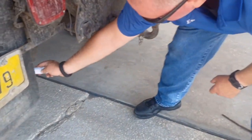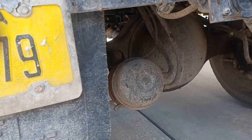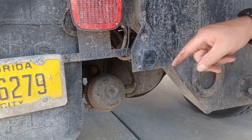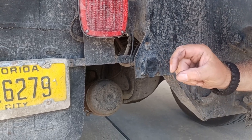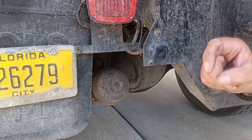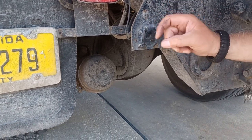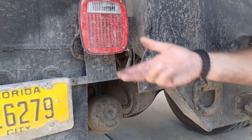Moving our way in from the slack adjuster, we'll see the brake drum and the brake liner back there. It has a dust cover, so we really can't see in there. What I would do is get a little inspection mirror, shine a flashlight in there, and look into that mirror to see whether or not you have more than enough brake pad. It should be more than a quarter of an inch — free of oil, grease, and debris, with no cracks. And there shouldn't be any cracks in the brake drum, just like the front one.